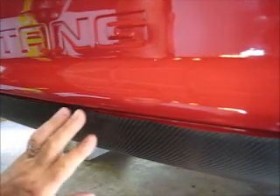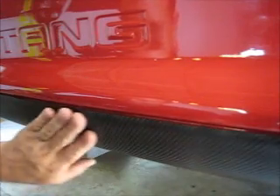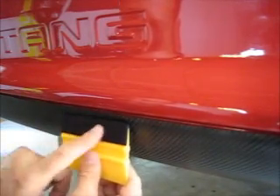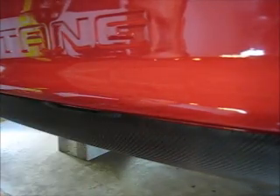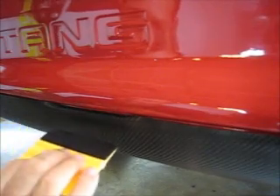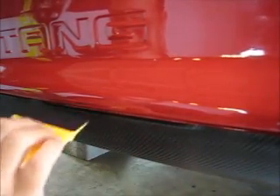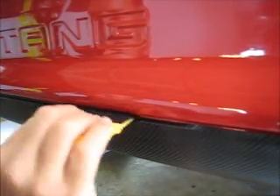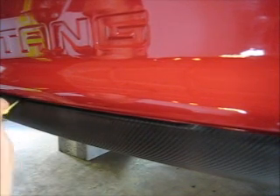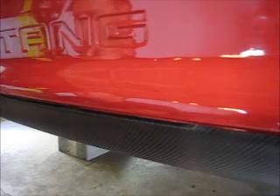I'll give you a quick show of how the channel's going to fill up with the extra carbon fiber vinyl. I'm going to take that felt-tip squeegee and literally just move it from the surface into the channel. As you can tell, as soon as you press it in there, the stuff just lays down because it's tacky. Work it all the way around the bumper to get it in there nice. Take your time — areas that have some curves, use the heat gun to get that material to conform to the curves and you'll be done in no time. Thanks for your purchase.